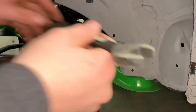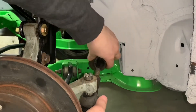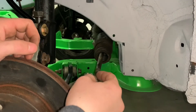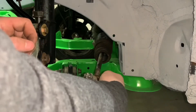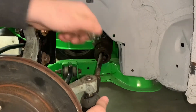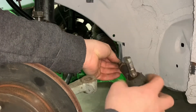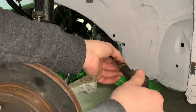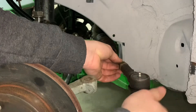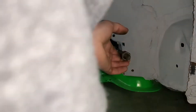From here, what you're going to want to do is take off your outer tie rod. I already have the bellow taken off. You're going to want to take your cotter pin off if you have one, then loosen up your jam nut that pushes against your outer tie rod. What I normally do is keep the jam nut where it was, so you can use that as your reference for when you put your new inner tie rod on for your toe, to make sure your alignment isn't too far off.